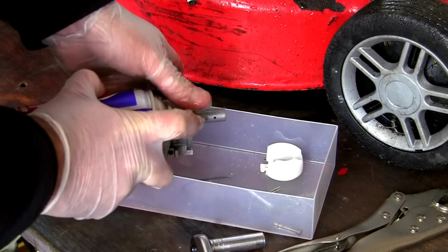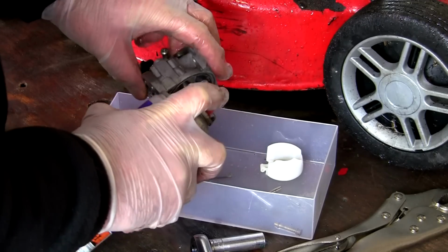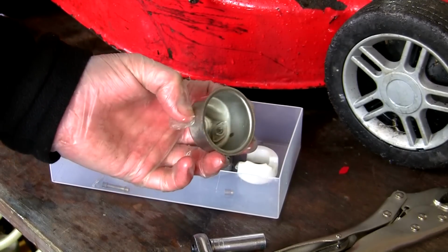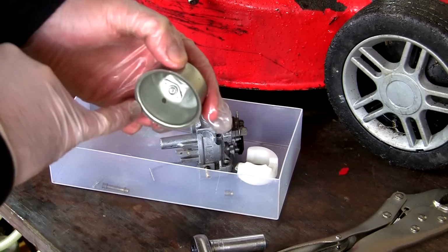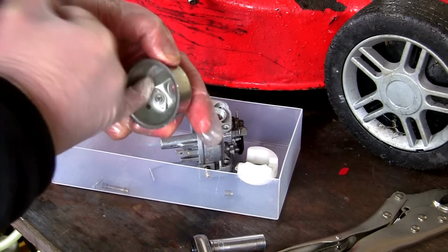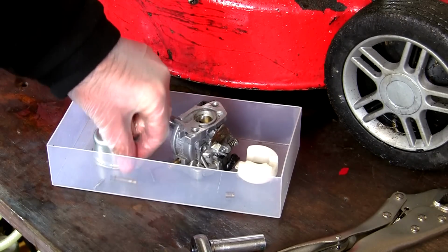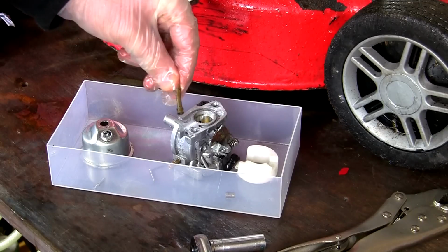And just make a really thorough job of cleaning everything out. It's really important that the whole thing is really clean and tidy. It's also really important to make sure this bowl's completely clean as well. Make sure there's no little bits in here. As you can see here, I've not done this one yet. Just little bits like that. That may just be rust, but there's tiny little bits that come off on your finger. And it only takes those tiny little bits of dirt to get through. If you can just see them, they're absolutely minute holes that are on this.